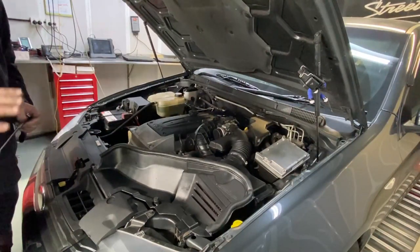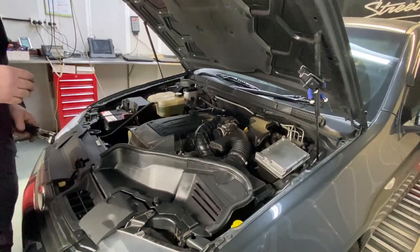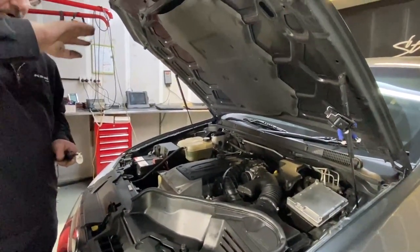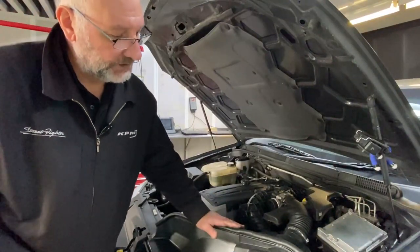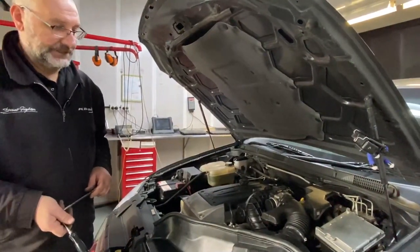Now what we're going to do now, we're going to give this the three power runs. We do three power runs to stabilise and give us an average of what sort of power we're getting at the wheel. So to get an accurate measurement, we'll do another three power runs with our full cover version and then we'll do our race cover and see what the difference is there.